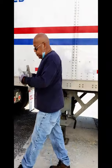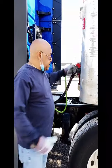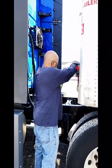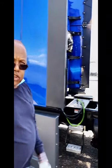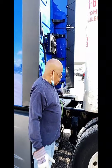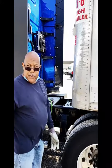Now I'm going to move back to the truck and trailer. I did engage both the brakes. Please make sure that you put the lines in their proper place, because we've had lines wrap around the drive shaft or the drive tires. Once you start going down the highway, that can very easily happen to you.